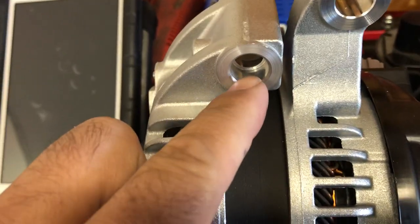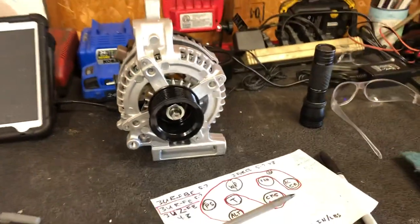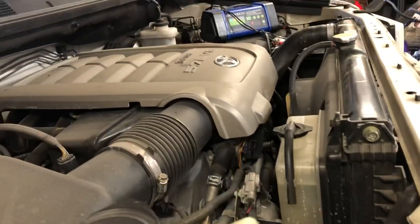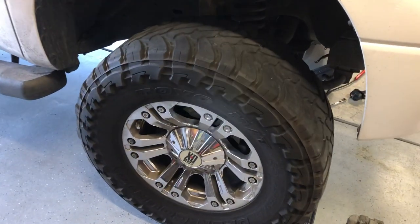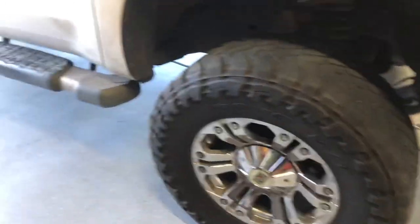There are two positions that take dowels, so when you're taking the alternator off be careful not to drop those — there's one here and one there. Most of this job was done from underneath. I didn't really need to open the hood besides to charge the battery, so if you have a failed battery, put a charger on it while you do this job and clean up the battery terminals. They recommend removing the airbox if you're attempting from the top, but since this truck's lifted I have plenty of room underneath. If yours isn't lifted, pull the wheel and put it on jack stands — don't just use a jack, use stands.